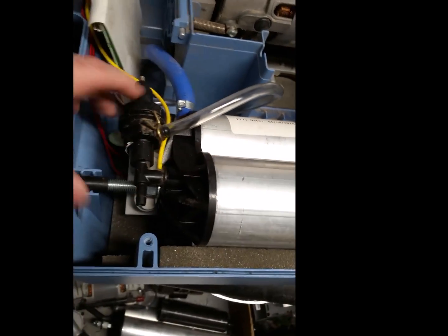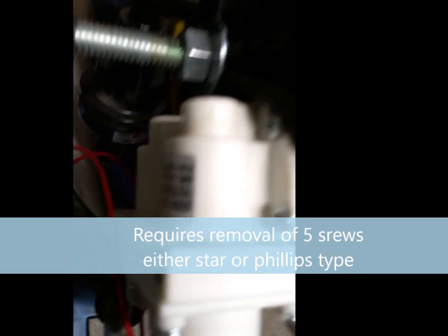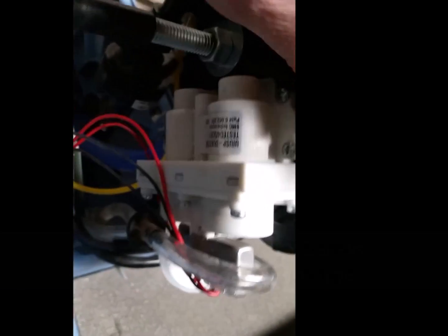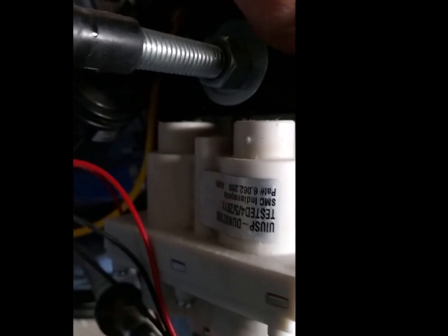The unit's been cleaned out. Now if you look at the sieve beds, we're going to flip them up — this is where you're going to see the solenoid valve. It's on top of the sieve beds. This is the valve housing, and we have to remove the valve housing. All there are is five screws — just Phillips — and I'm going to use my driver to remove those five screws, and I'll show you how to remove it from the PCM.